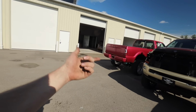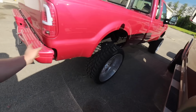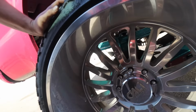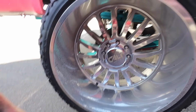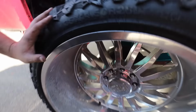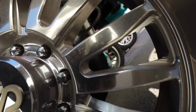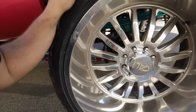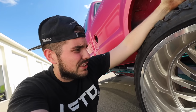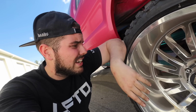I don't know what we're going to be doing, but I think we're going to be pulling the tranny on this thing, getting this thing built. We also need new calipers all the way around, I think, because this one back here, just disregard all the oil that shot out of the stack. But look at this caliper. There is zero friction on that. And then this one is literally gouging itself out. So that's half the power problem in this truck. I can't even lay down all the power. Plus I think this truck one wheel peels, but after this caliper is unlocked, I think it'll spin both of them, which would be sick.